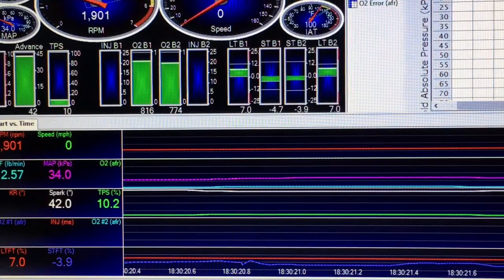I am totally impressed at the gains I've made between 2,000 and 4,000, but I've got to figure out what I've done wrong that's causing the computer to pull timing from 4,000 to 5,100 plus. I need to go in, extrapolate my data, look at all the points, and find out exactly what I did wrong and what I need to fix. Trying to stay away from 92 octane gas and stick with 87, but I may be limited to the power I can make at that octane level.